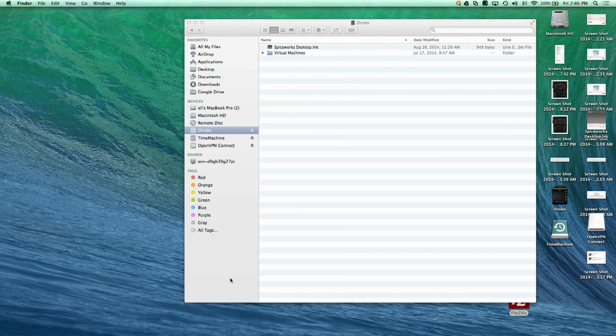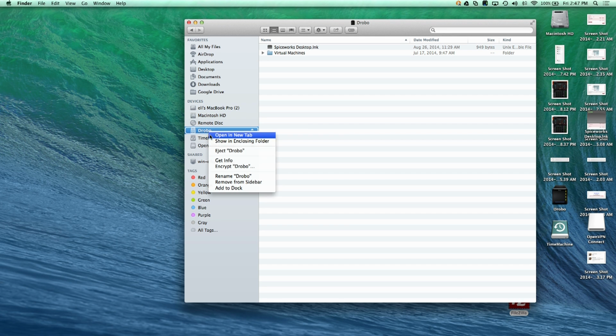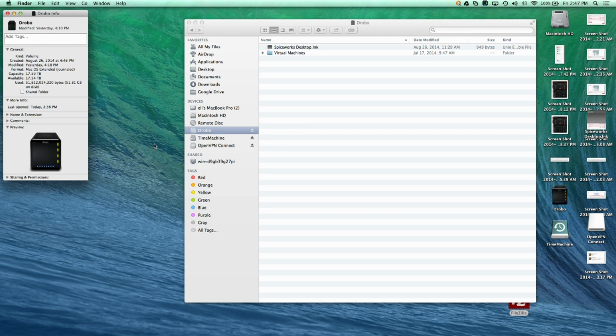One of the other things they do to make life easier for you with these Drobos is something called thin provisioning. Normally when you create a volume on a hard drive, it's a set size, 1 terabyte, 5 terabytes, 200 megabytes, I don't care what it is, but it's a set size. And if you want to change that partition size, you have to go in and mess with it manually in order to make it bigger or shrink. Well, the cool thing with Drobo is thin provisioning. So as far as the computer is concerned, you actually have a lot more storage than you in fact have.